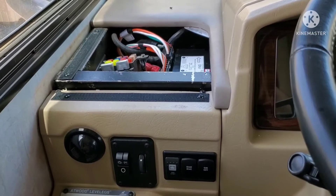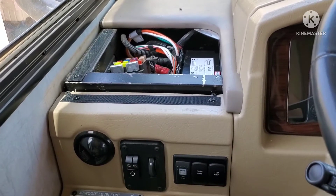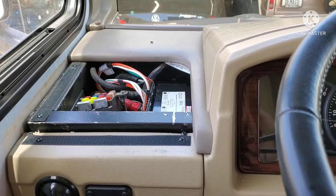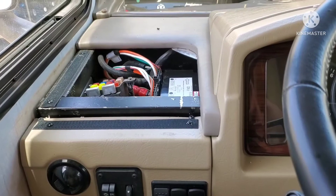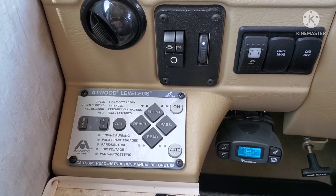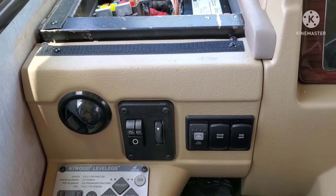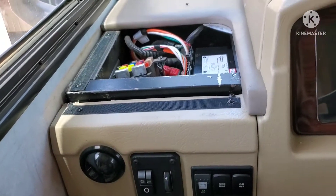It was loose — really loose. So I got some electrical connection cleaner, sprayed the connections, and tightened that one connection down. It didn't show a voltage drop at rest, but obviously when the vehicle's running you've got vibration and movement causing voltage loss. I cleaned those connections, tightened them back up, started the vehicle, checked my voltage at the battery, checked voltage on both sides of that circuit breaker, then came back up and checked my voltage at the control unit.